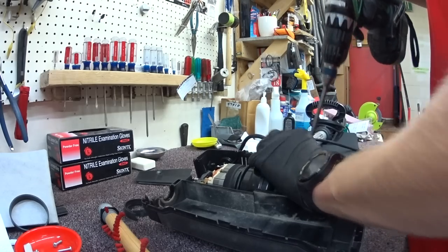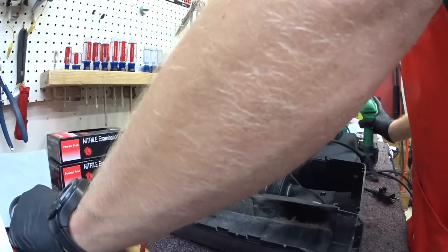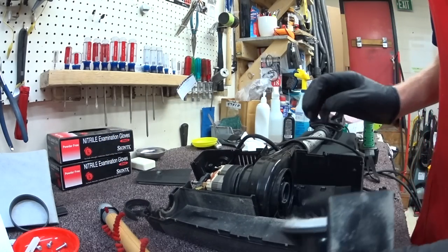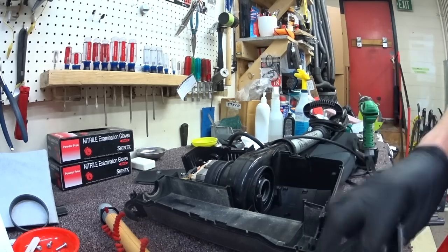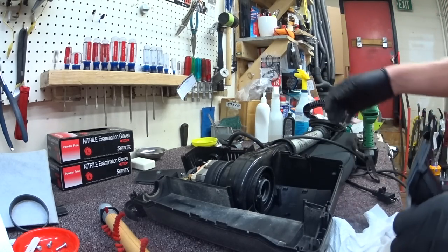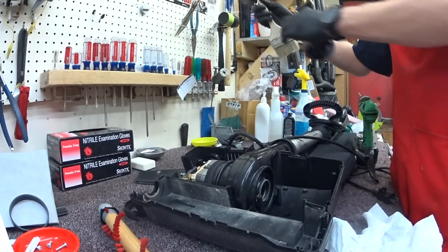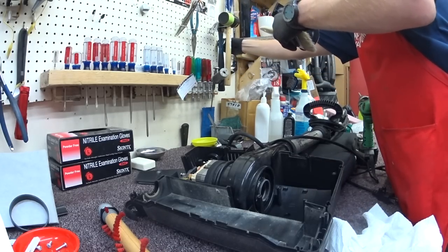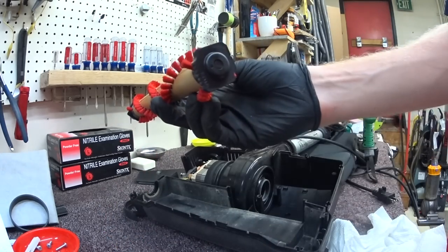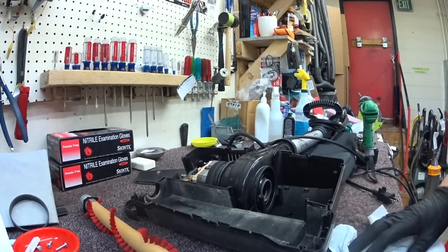What's cool about the XL21 platform is it's mechanically very similar and uses some of the same parts — basically the same motor — as the Oreck Classic, which is what most of us know as the original Oreck, in the lower models. But it moves significantly more air, and because the brush roller is on a smaller pulley it spins more per minute.